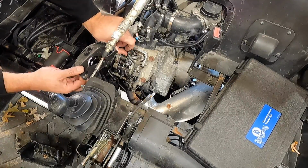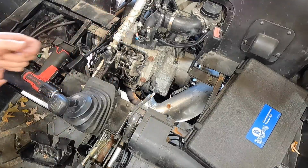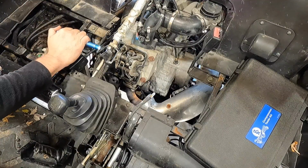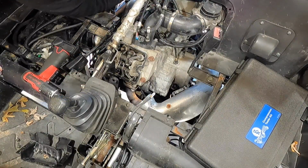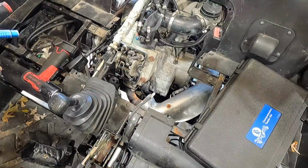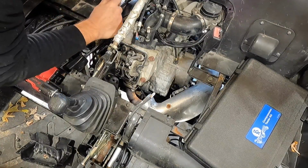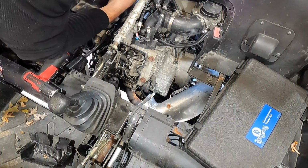All right, so put the valve cover gasket back in place. Grab my flashlight for timing marks here. I see the timing marks. I'm gonna go ahead and remove the rear cylinder's spark plug also. That way it makes turning this thing over that much easier. Access can be a little pain in the butt.